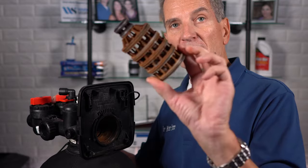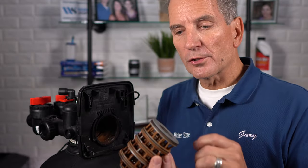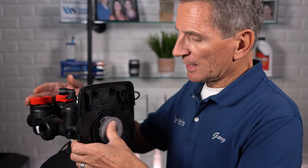As you can see, the seal pack is quite used and dirty. You can clean it at this point, but if it's leaking past the seals — which is what's causing water to run to drain — you're just going to throw it away anyway. Replace it with a new seal pack, which just slides right in.